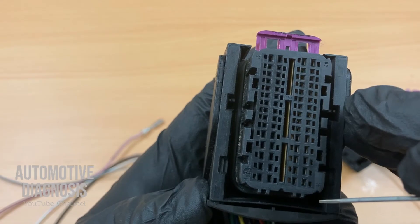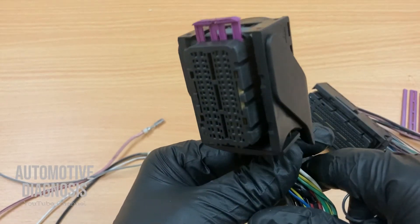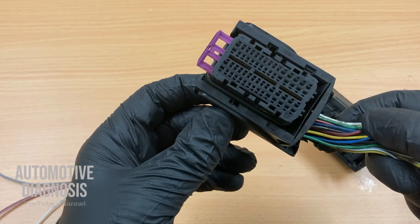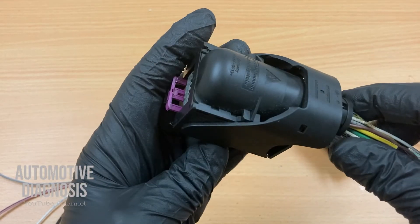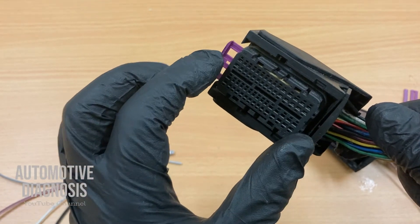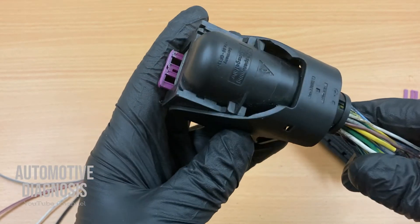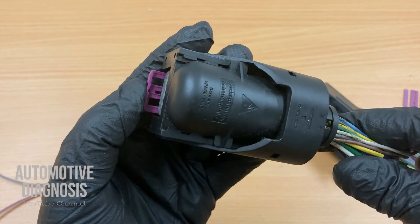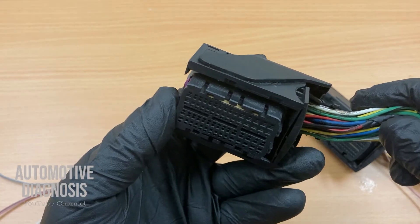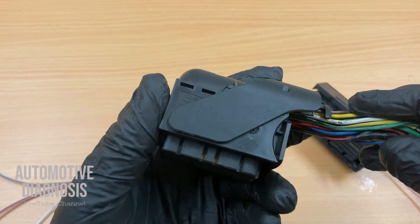Insert the tool, release the retainer, and remove the pin from the back. As you saw, it looks really complicated but actually it's not. All these covers over the connector make it look complicated, but by focusing on the connector shape, how to reach the retainers, and how to reach the back of the pins and wires, you will find it super easy. Please watch the other episode for removing pins from connectors, and put your comments about any difficulties you've had doing this job. Thank you, see you soon in another episode.